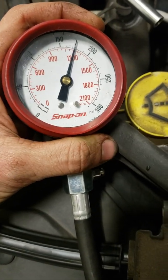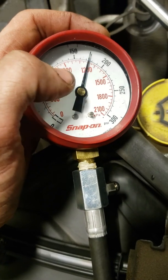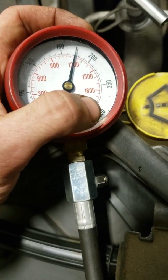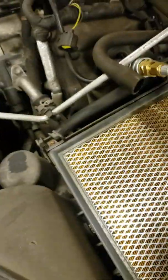That's absolutely perfect. The engine likes to be anywhere between 140 to 150. Higher than that's okay, but excessive would be up in the diesel compression range. This cylinder's good.